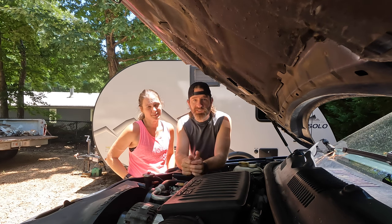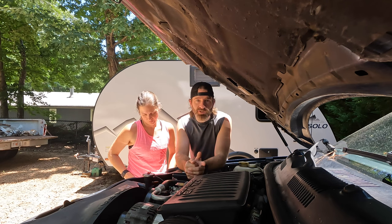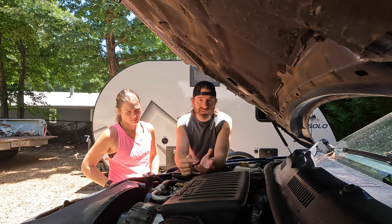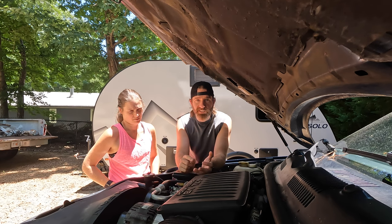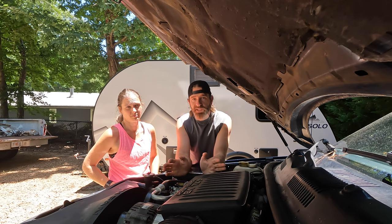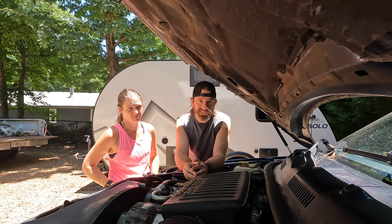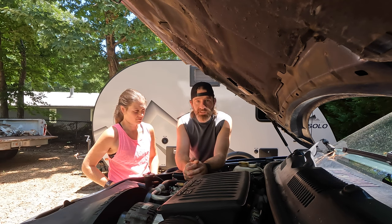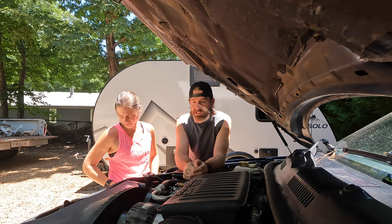Taking a little time this afternoon to work on the Cherokee again. It's got a few weird electrical things. When I was driving it home, I had two different times where it beeped and the ABS light flashed on and off, then the speedometer quit working — all the other gauges kept on but the speedometer quit, the AC quit, and the turn signals quit all at the same time. Then after a minute or two they all came back on together. If it was just the speedometer and ABS light I'd think a wheel speed sensor, but the fact that the AC and turn signals coordinated with it — I'm gonna go down the route of a ground or something. There are a couple of ground cables on the engine I'm going to pop off, replace, and then clean up the others.